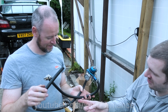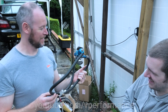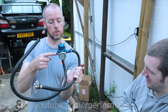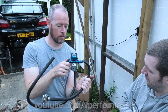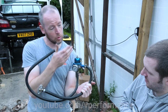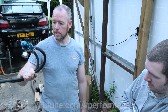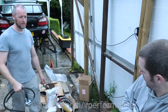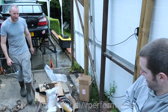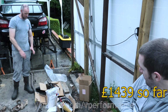That shows you how old it is, and suitable for unleaded. And it's measured in inches. Yeah, it's 3/8 inches. Anyway, this actually allows you to run 2 separate fuel inlets if you want to, because it's a 3-port. Now, I don't think we'll ever do that, but it's good to know we've got the option. So this will allow us to regulate the fuel, because this controls the fuel pressure faster than the standard one, and it's got slightly higher capacity. So this is better for a car which has already got some fuel starvation issues. That's it.